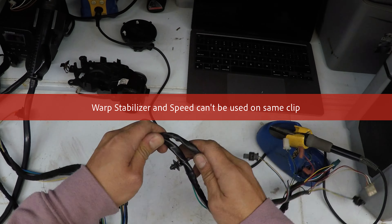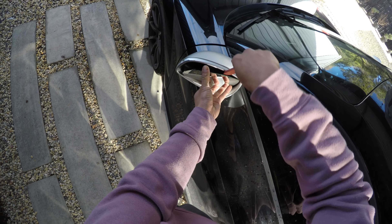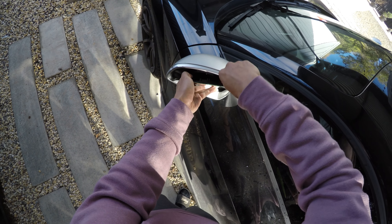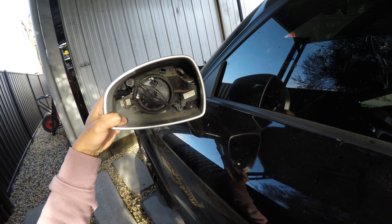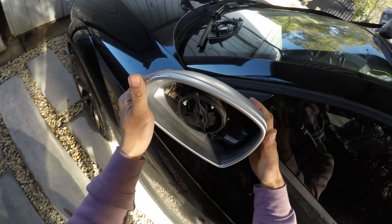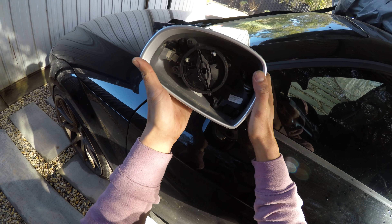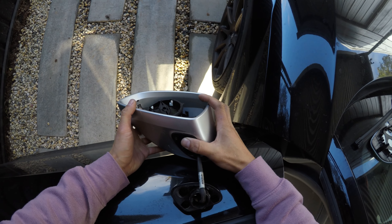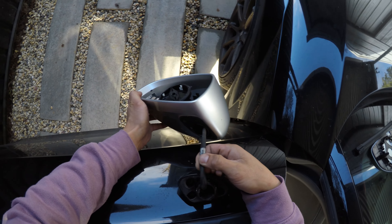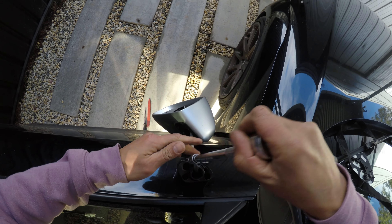Now that that fiddly part is done, next is to remove the wing mirror from the car and swap in these upgraded parts. Removing the wing mirror can be tricky. The first thing you need to do is adjust the mirror all the way in and down to get your pry tool in there and remove the glass. Try and keep even pressure on the front of the glass by spreading your fingers along the rim, and don't use anything metal to mitigate breaking the glass. You'll need to use a little bit of force to move the unit all the way to the back to unlock it from the base. Once unlocked, remove it from the base and remove the original wiring loom that connects to the door control module. The best way to do this is to remove all of the wiring from the mirror housing and feed it down into the door and out. There are a few fixing points inside the door to make note of for reinstallation to ensure the window glass doesn't foul the mirror wiring loom.